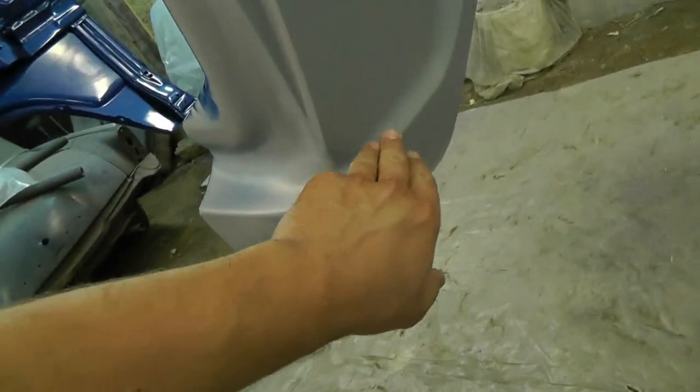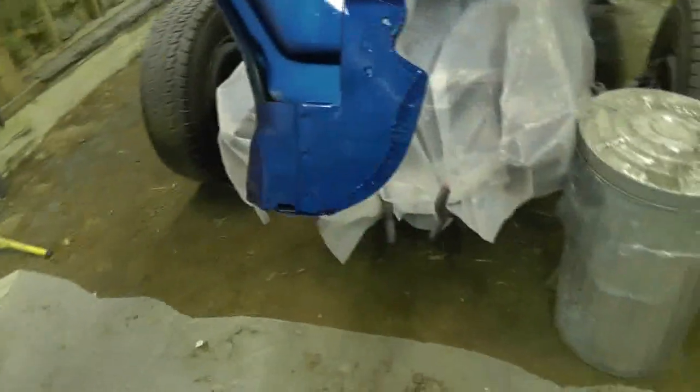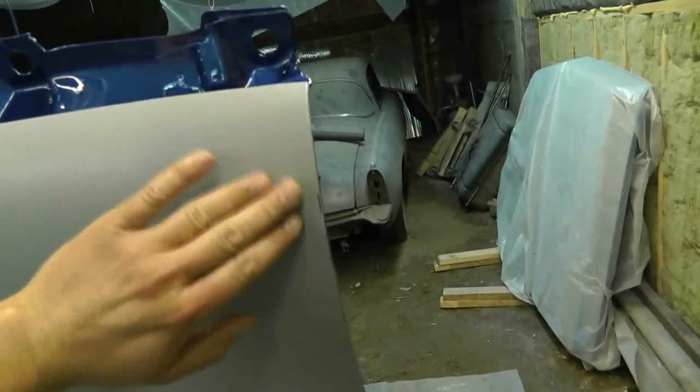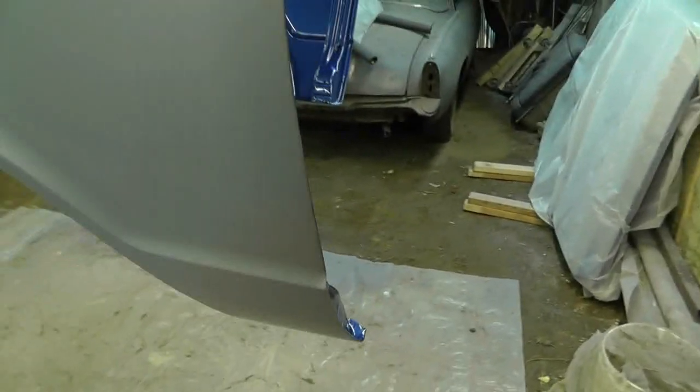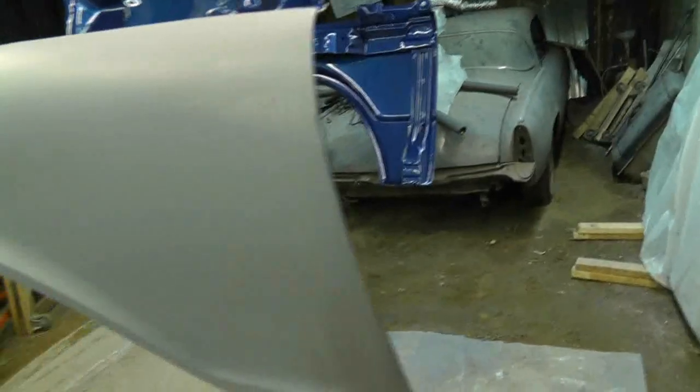I also have to do a bit of primer touch-up on this fender — it never seems to end. That's where I sanded out that run the other day. I'll clean out the holes on this fender, then just hit that with a trivial amount of primer there and over on the upper right-hand corner. If I wouldn't have sanded through it wouldn't have been a problem, but I don't like that I can see through to the EDP. The run is gone, but I might give it a little bit more just to make sure, then just hit it in that one spot and not touch it again.